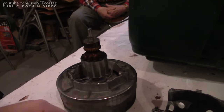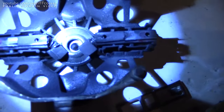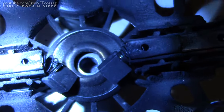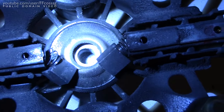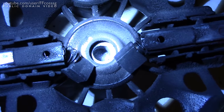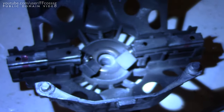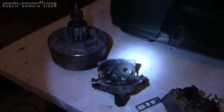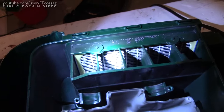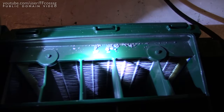That's moving a lot. Really not good. It does spin well, though. But I think that's caused — it's probably not going to show up on camera — but it's caused the rear bearing, or rear bushing, to get entirely eaten. As you can see, it's oval — it's no longer round. And you can see the brushes are just entirely destroyed. That's probably all this black stuff we see in the HEPA filters — it's just brush pieces, and I think that crap on top there is probably brush pieces as well.